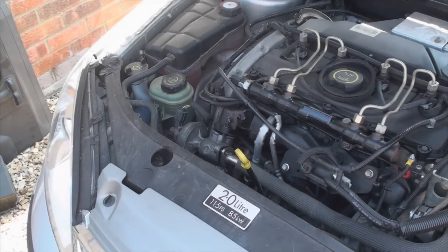Today I'm going to be talking about the EGR valve on a Ford Mondeo MK3 TDCi. If you're watching this video, the chances are that your Mondeo has developed a fault. If you've noticed loss of power, excessive smoking while accelerating, engine management light staying on, or a flashing coil symbol on the dashboard, or a combination of those, it might be worth checking the valve.